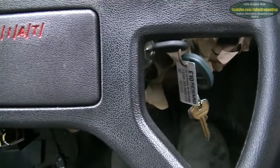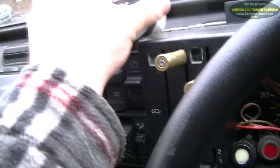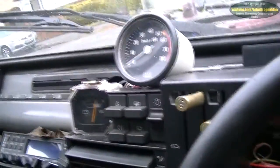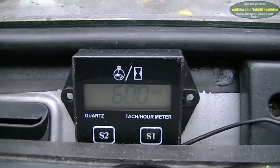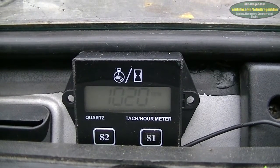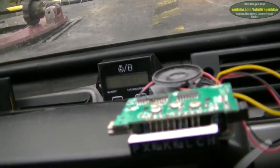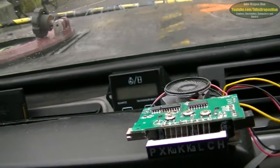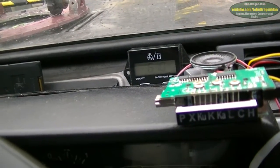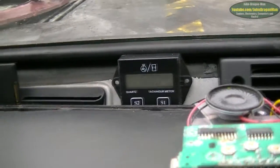Let's give it a little rev and see what it sounds like. That sounds happy enough. I need to get my analogue rev counter wired in. It's been sat on the dashboard for ages now, and I thought it would have come off by now, but it actually sits there pretty good. I've just got that one there, which is from a lawn mower. I don't think I'm doing 570 RPM — it's a bit off. It's one of those ones where you wrap it around one of the spark plugs and it gives you the reading, but obviously with this being a twin coil, it picks up twice, so you have to set it into some weird twin coil mode.